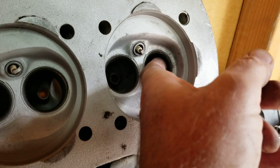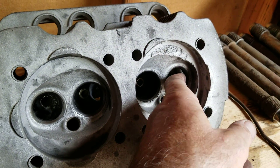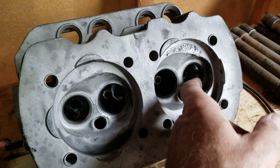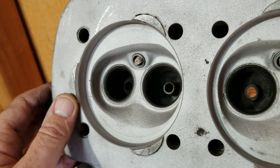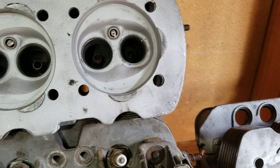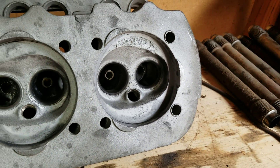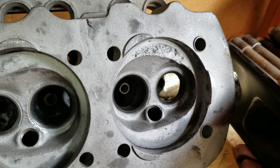Because if you take it all out, you're eventually going to drop a valve seat and that's not fun. But you can take out quite a bit of it. Here's a stock single port — I can't even get my finger in. After I'm done I can get my finger all the way through, so that's how much you can go. There's still enough support there. You can see that ridge right there on the single port — it's very restricted. On the ported side it's way more open, a good quarter of an inch more flow from the exhaust, which will really help the single port run better.